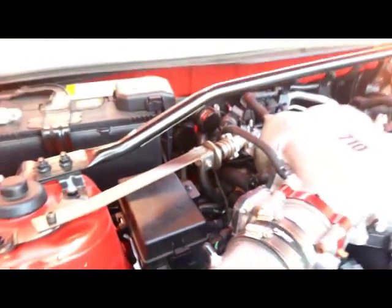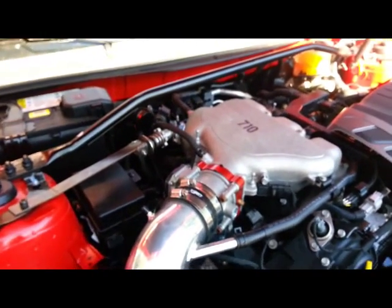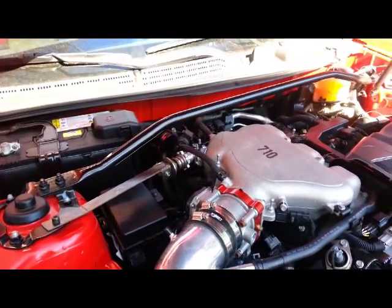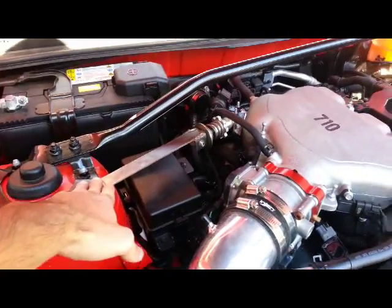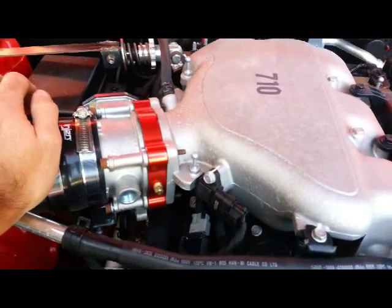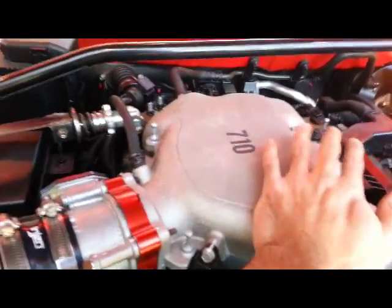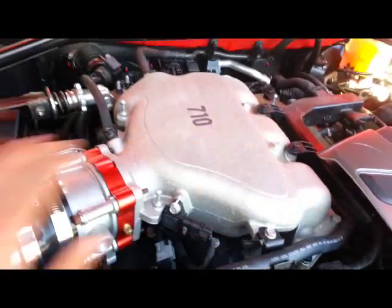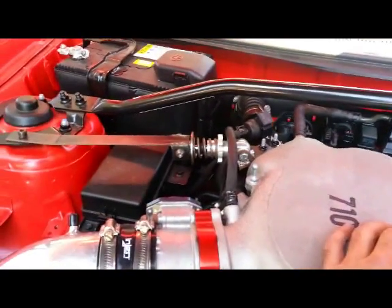Basically, I wasn't sure if I wanted to get engine mounts yet, so I just fabricated this so I didn't have to worry about having issues with motor mounts being too aggressive. Keeping it simple and straightforward — I have all the drivability with this, but under hard loading it's going to dampen the movement and keep the engine much more stable. It's supposed to compress; it just keeps the engine a lot more in its place with a little bit of movement but nothing too bad.